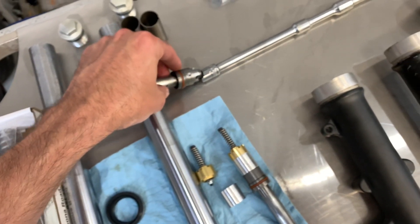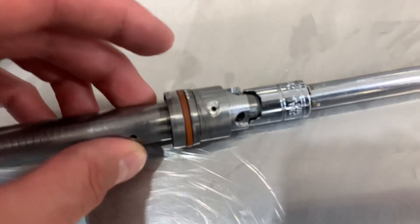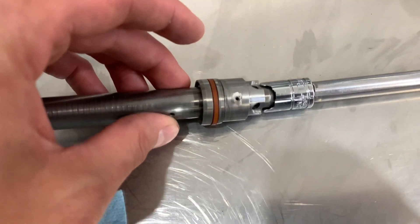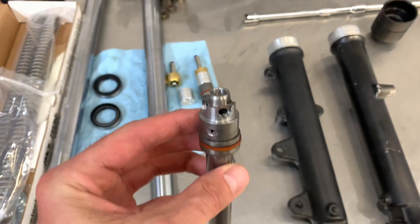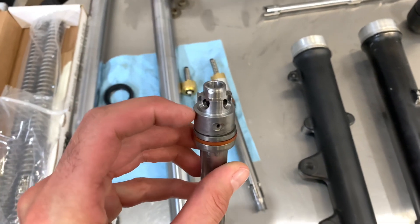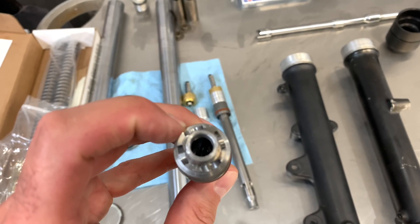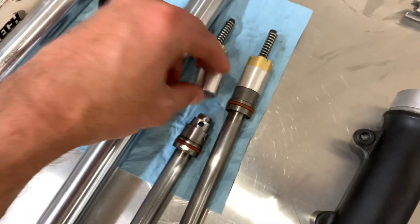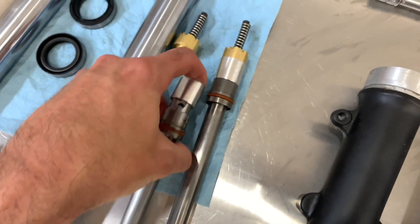You can see the tool that I made — it's just a 12 millimeter that I cut a slot into, and that matches into this here. So I modified it by milling slots in and then turning it down on the lathe, as well as drilling a hole in the top center. This is how it's going to work. I made these small little adapters and that one just slides right over top.